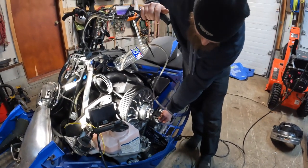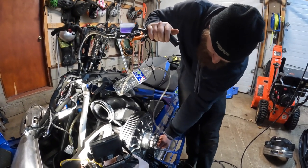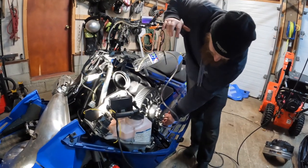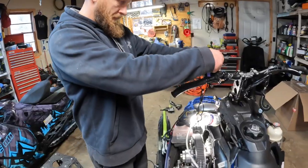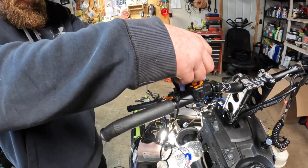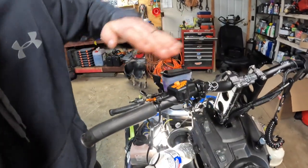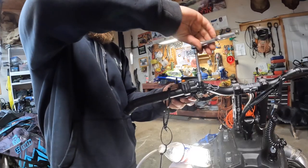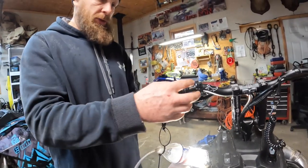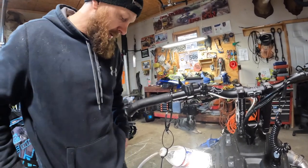As you keep going, you'll feel it get harder and harder each time. Now when I pump it up three or four times I've got a nice stiff lever, then open it up. Especially when you're riding off trail, brakes are important - you use that brake a ton, use throttle and brake to get the sled off and get it on its side. One thing we're going to do is actually turn this so that it's level - I forgot that part. I just loosened up the brake perch here and made it level so we can make sure the fluid line looks good and get the most fluid in the brake reservoir.